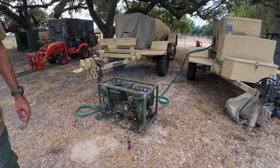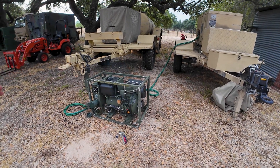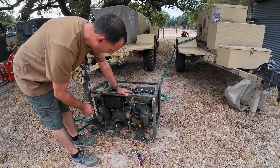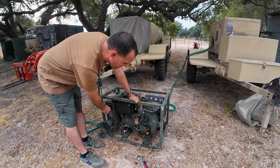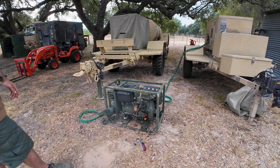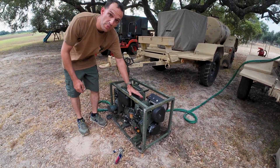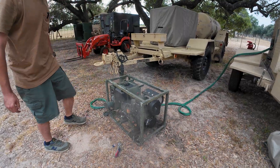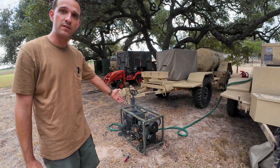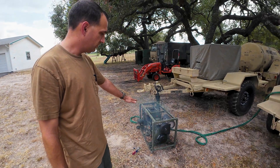So it did start to get fuel. It's going to stutter for a little bit because it's barely got the air out of the injection system side. It may or may not stall out. Okay, so it stalled out. Now what I'm going to do, because I know it got a good chunk of the air out, is hold the decompression lever again and do like another 10 seconds. You might need to just continually repeat this process, and as you're repeating it, it's just going to get better and better. You can see already it is slowly getting better — it may be able to just sit here and not even stall out again and the RPM is going to come up.